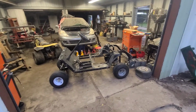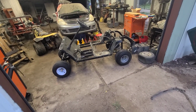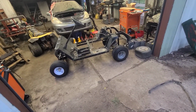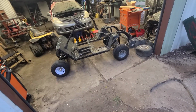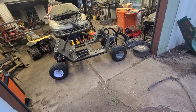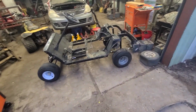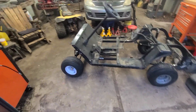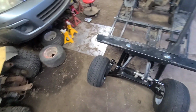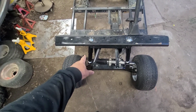All right, guys, here we go. Suspension is done. Well, it's not completely done. I ordered the heavy-duty rear springs because I'm going to put a rear flip seat on it. And it came with new bushings for the springs, but not the frame where the shackle hooks up. How cheap is that? You couldn't throw a couple sets of bushings in there for that. But anyway, like I said, we had to drill the mount out. We had to drill those two bolts out, bolt all that up.